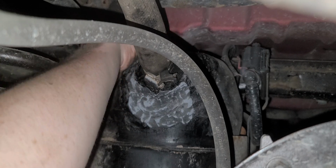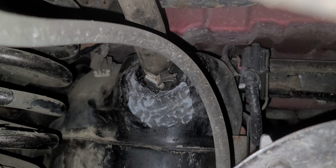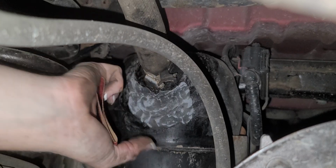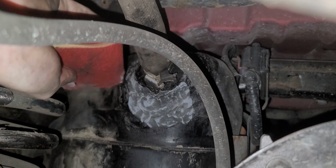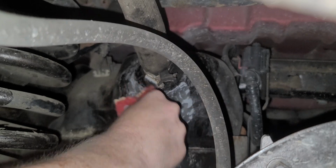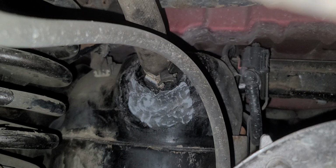There is a bunch of gooey yucky stuff up here. Look at that, I think you guys can see that. That's gross. I need to do a scrubby scrub. And this stuff on here is JB Weld specifically for fuel tanks. I'm in a weird position doing this by hand. Basically, you're supposed to sand the surface and scuff it up. Then I use alcohol because it's a good preparatory thing. So husband cat gets out here with the alcohol, and I also need paper towels, please.